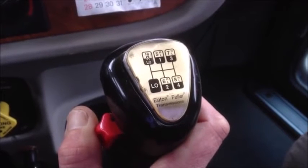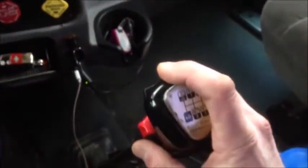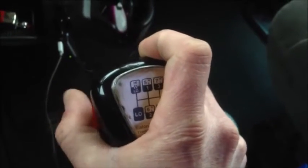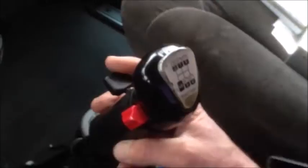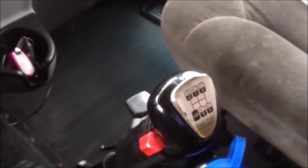If you want to go down to six high, push forward on this to select our high range, then shift normally into sixth and we are in six high. If we want to go down to six low, pull back on that, let off the gas, step back on the gas and it'll shift automatically into six low. You can just keep working yourself down like that. I know it sounds a little complicated — it takes a couple of days to get used to it. But if you've driven a 10-speed before and gotten comfortable with that, you can drive a 13-speed.